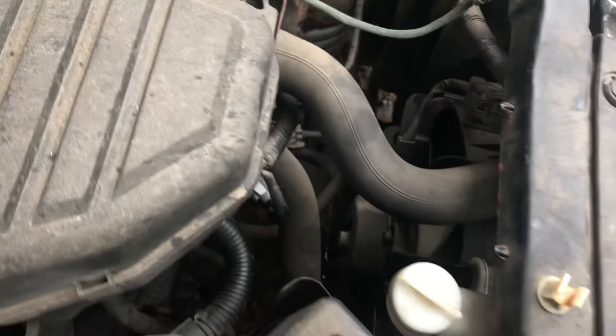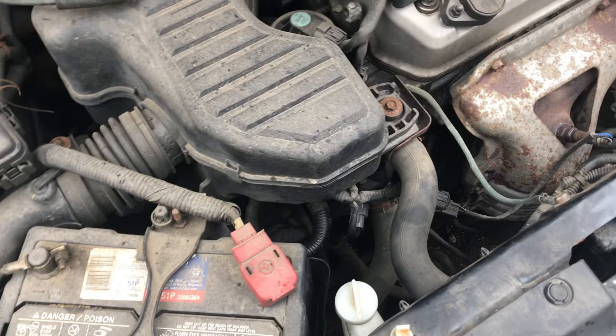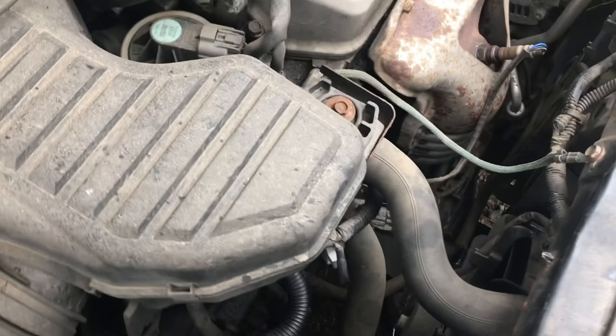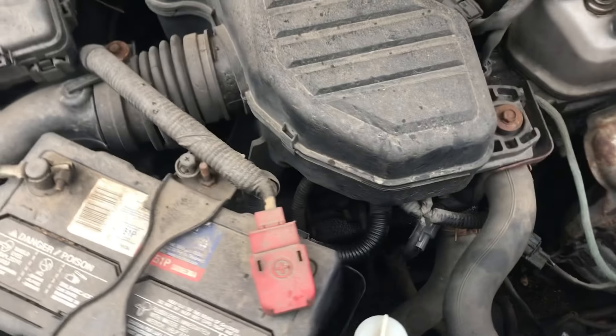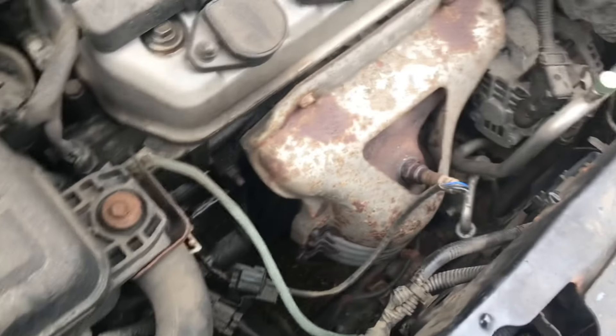After that, you want to see if the fans are good. When the engine hits about 95 degrees, the fans will kick on. My issue was my fans were not coming on, so here's a quick way to prove whether it's the fan itself or the coolant sensor.